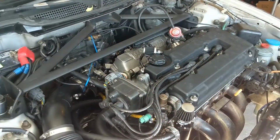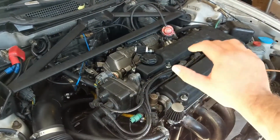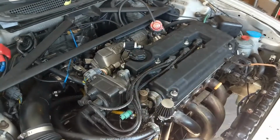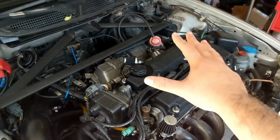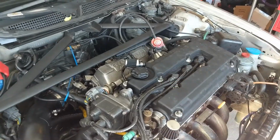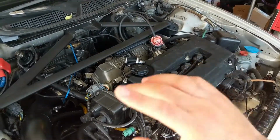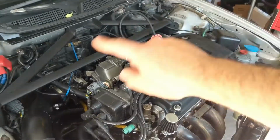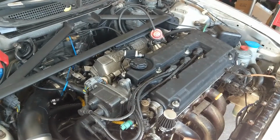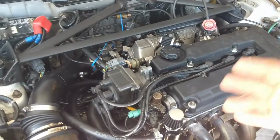The issue with that is, when you do some research on it, it's the best setup for a B series, right? Good for 25 psi, guys use it all day long, reliably. If you're drag racing. I found some other guys who did the same thing as me who do autocross and road racing, and they had the same exact issue. When you add corners into the mix and you get those G-forces, and the oil starts to slosh, it pumps the oil through these hoses and fills it up prematurely. So we were filling it up super quick and it was blowing out of the top.